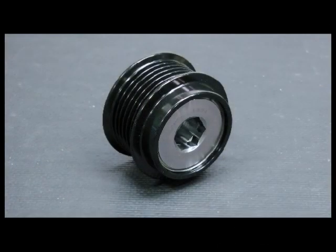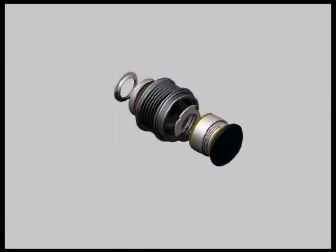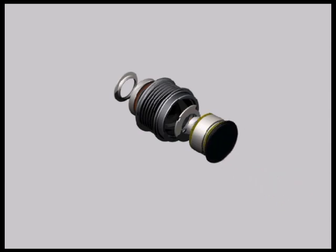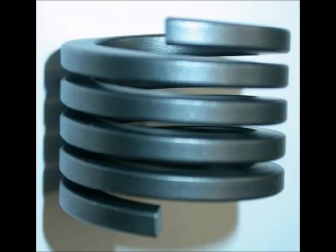And now, the OAD. This stands for Overrunning Alternator Decoupler. The OAD not only has the one-way clutch inside the pulley to address the belt chirp noises, just like the OAP, but it also incorporates a special steel torsion spring that absorbs engine vibrations caused by the firing of each cylinder and the lower idle speeds of newer engines.